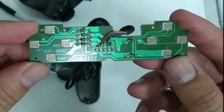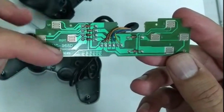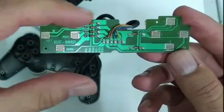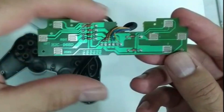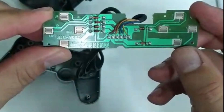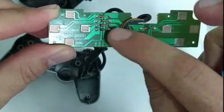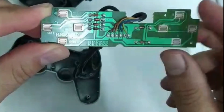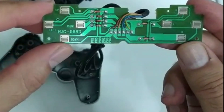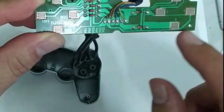This actually looks like the one I designed myself. It's just got some exposed tracks here for the buttons to make the connection. It looks like it's just a simple switch circuit here - close the connection and it activates the button. It's got some diodes here which we don't really need in this circumstance. This must be to stop two different connections interfering with each other, and it also has some shared ground signals by the looks of it.